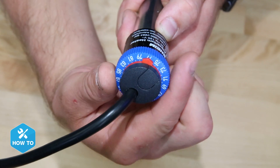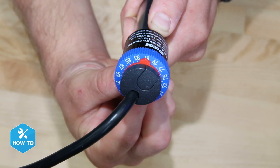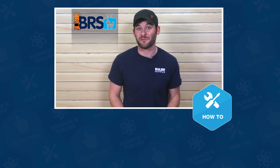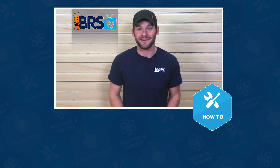Finally, the last step is to set my heater's built-in control to a few degrees higher than my desired tank temp, which will allow it to be controlled exclusively by the Reef Keeper. That wraps up this installation. If you have more questions, please don't keep them to yourselves — give us a quick call or email, and if you need your answer in the next 60 seconds, hit us up with a chat. See you in the next episode of BRSTV.